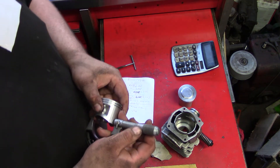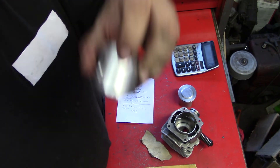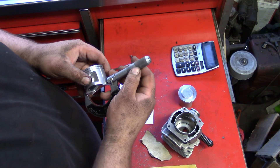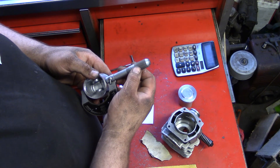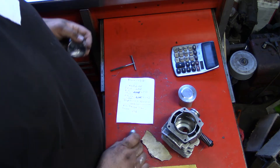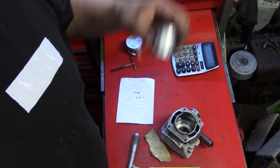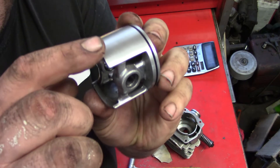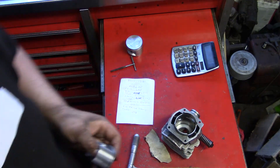Just for giggles — let's check this. This is the piston that came in the kit. I couldn't use it because the pin was exposed and the ring would pop right out. Let's measure this up just for fun. Make sure you guide your pistons up, real slow, get a nice little drag there — just feel it. Same clearance as this, so we're perfect. I don't know why these 372 pistons — I don't know if it's the tooling. This one was like — I'll exaggerate it — from here to here it was ramped, tapered like that. But I fixed it.